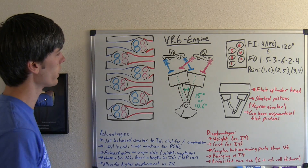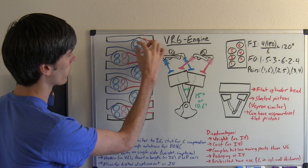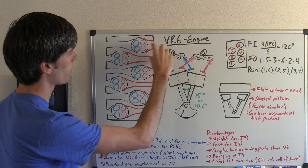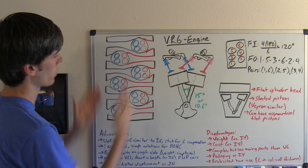This diagram shows four valves per cylinder on a VR6. You've got an intake channel feeding two intake valves that open up, then the exhaust valves open up and all the exhaust comes out the other side. You'll notice there are different length runners to each of the intake valves depending on which location they're at.